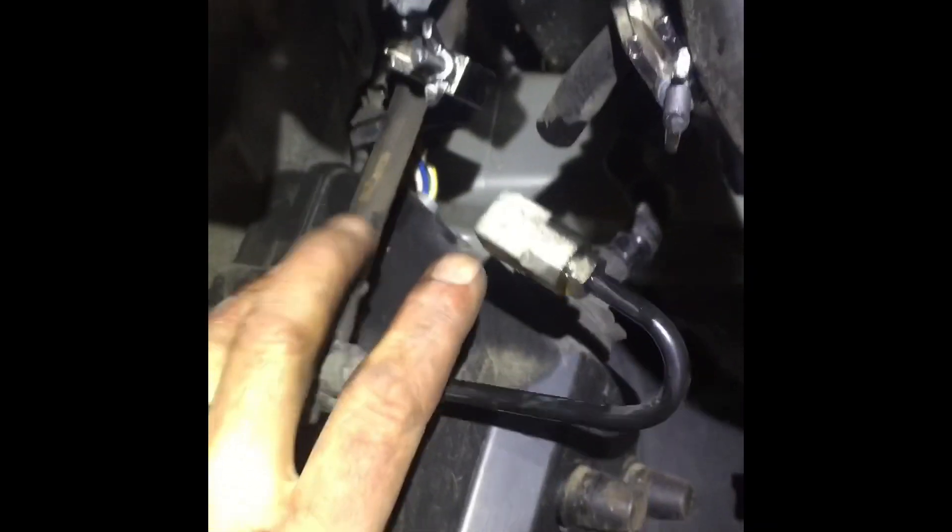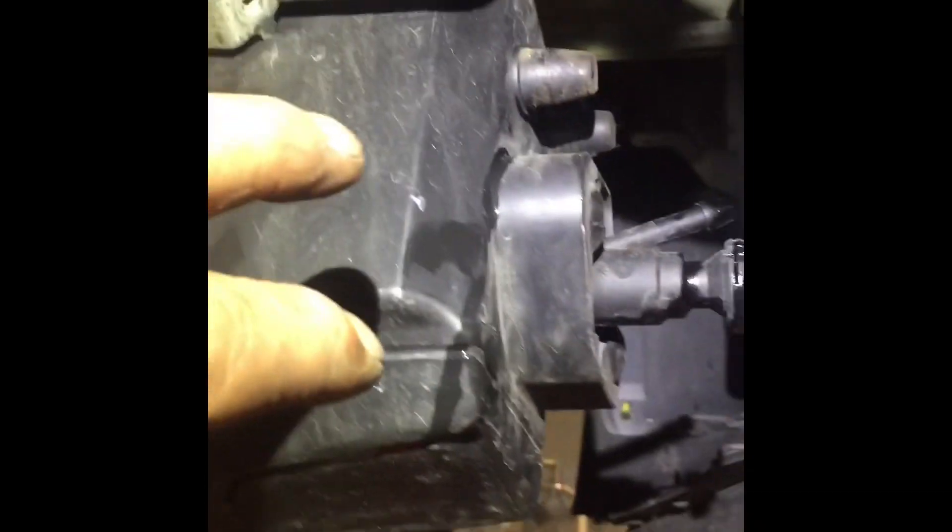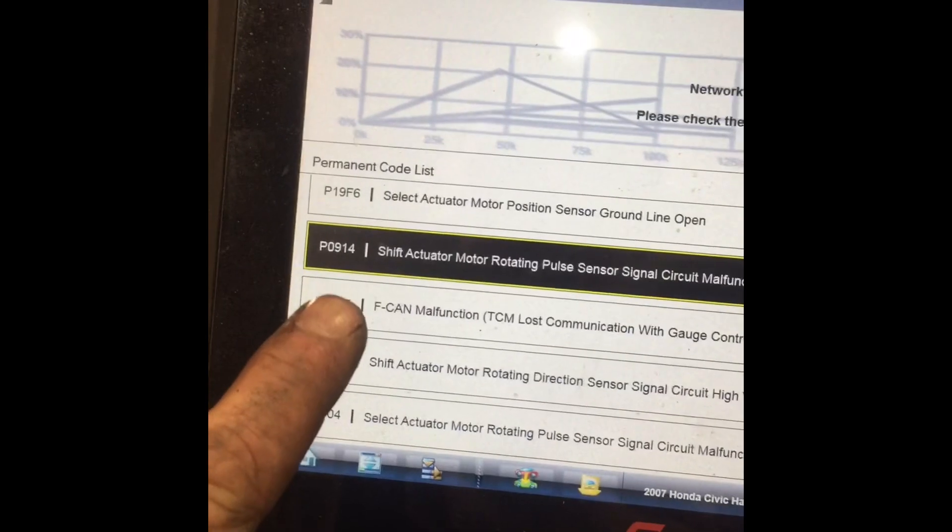Just to show you — the transmission control module is inside in the workshop. I have a couple of bits on the ground: the under-tray came off, and this steel box was housed up at the front. There's a cross member, there's the gearbox — it's housed up here. There's a clutch master cylinder hanging out of it. I had to remove the battery above it to get down to a couple of bolts, and now I'm pulling off the hydraulic pipe off the clutch slave cylinder. The transmission control module is changing gears and pressing the clutch — we have a clutch operation problem.